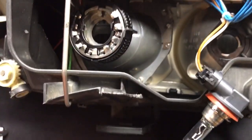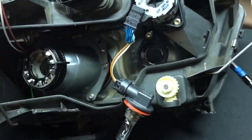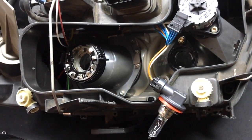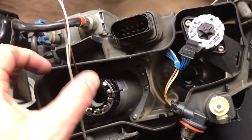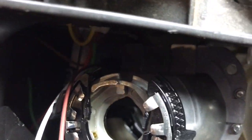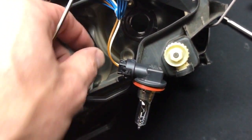That's all I did — I didn't do anything extra — and it is in there real solid. For peace of mind you might want to figure out something extra, and guys who take their lights apart would probably want to do something up there, but this thing's rock solid, it's not going anywhere. I'd feel pretty comfortable with just the two screws. When the projector's in, you can go ahead and mount your high beam wires. These are the high beam wires and they plug into a little plug back there.